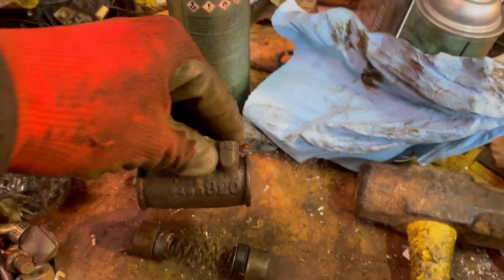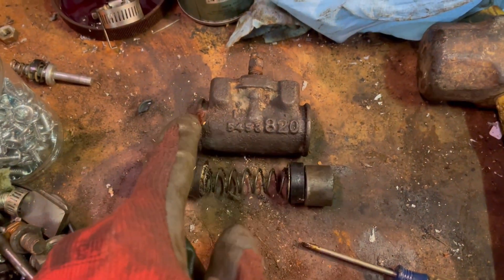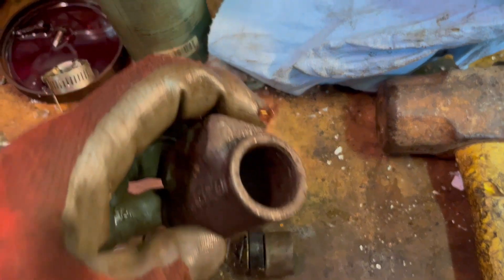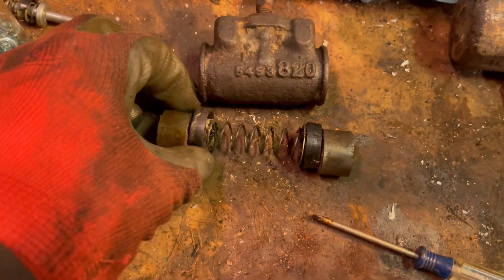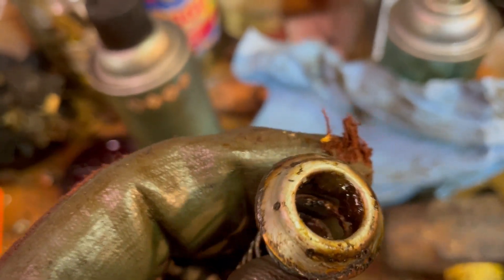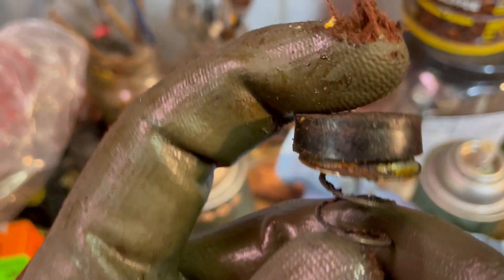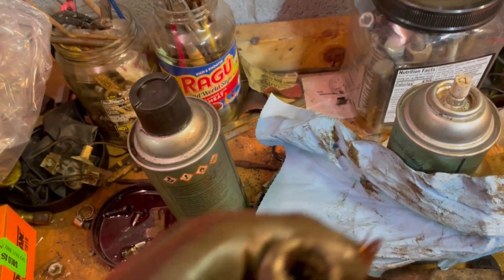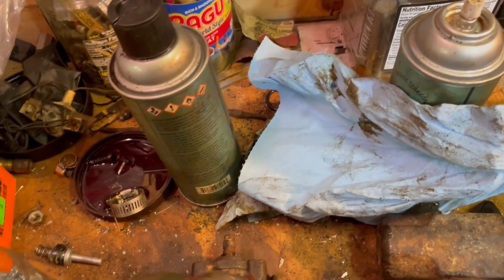It's not so rusty in this case because there was still some decent brake fluid in it, but the ends had fused right to the ends of the wheel cylinder. Also, look at the spring — the spring has to have a nice edge in order to push on the rubber cup effectively. One of the edges is completely rusted away, so that was a failure point.